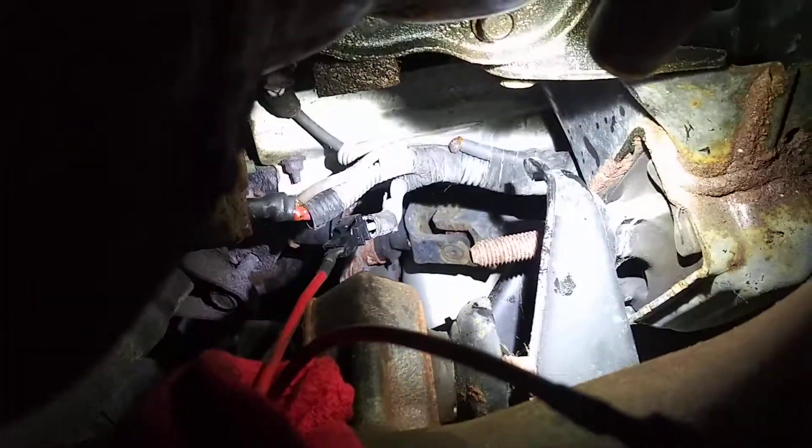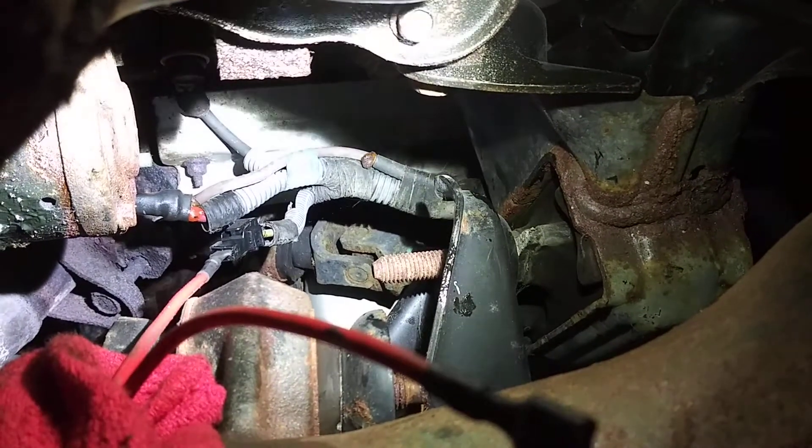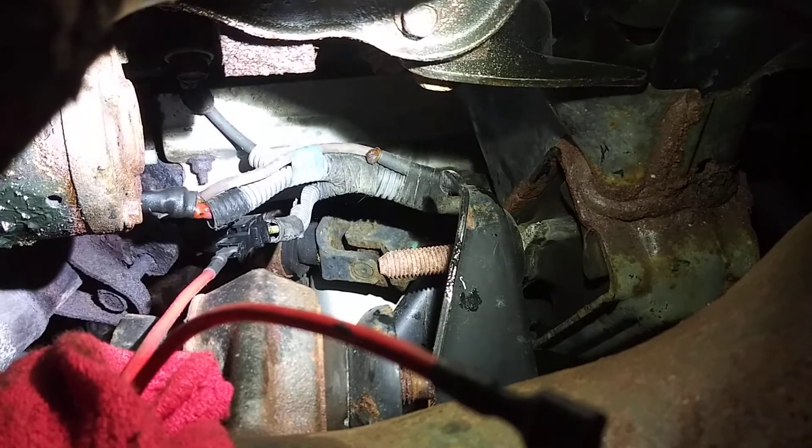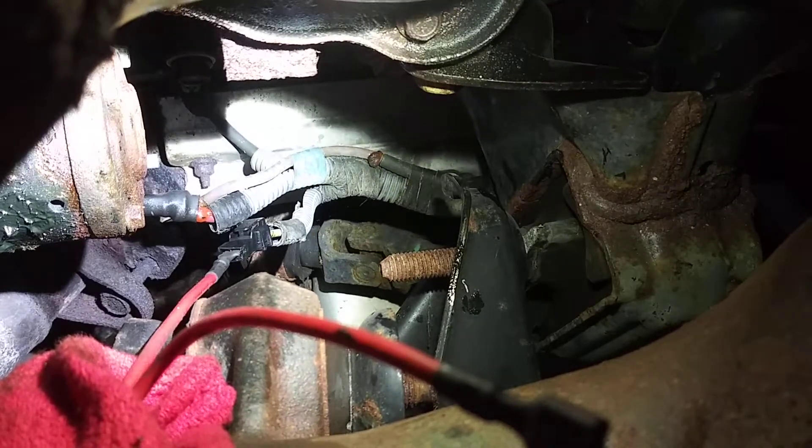So what does all that mean? We're underneath the car right now, and what we're going to show you is the actual starter motor. You can see the starter motor has a big red cable going to it — that's the battery voltage. And then you can see this other wire that we've tapped into with our meter, which is the signal wire. It's a yellow wire. That's the voltage we were just monitoring with the meter. So when you turn your key to start position, 12 volts comes onto that yellow wire and engages the starter.